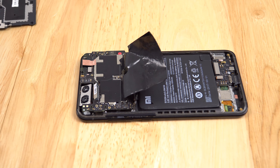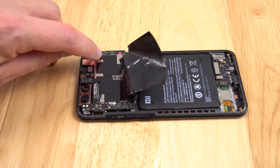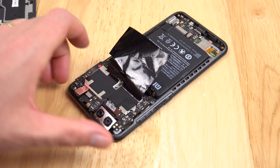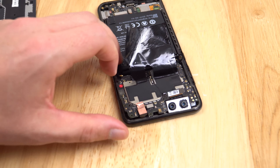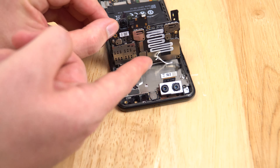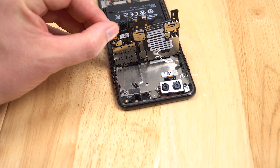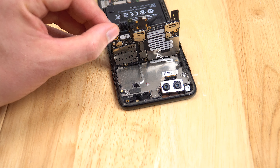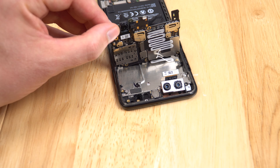The dual LED flash and camera module are visible here — front-facing camera too. There's some shielding around the Snapdragon 835 chipset, with a thermal solution underneath. The back of the motherboard, if you lift it up, you can see everything is screwed into the inner metal frame, with glue acting as a huge heat sink. The internals transfer heat to that, which is why it doesn't get hot — I've been gaming on this for a couple of hours and it only gets slightly warm.